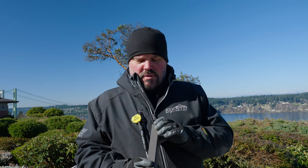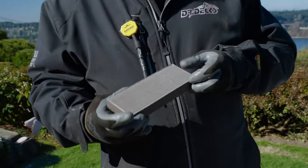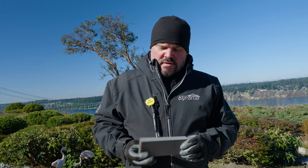We're going to use some glue and activator to get this to stick. It's like PVC cement on your sprinkler system — once it heats up and you lock it in, it really doesn't go away. It doesn't dissolve, it doesn't fall apart; it bonds itself together just like PVC pipe, and once you glue those together they don't leak, they don't fall apart, they withstand pressure. We're using that same technology. You'll notice that once this is done there's still going to be an exposed edge, so we'll take some color-match paint and detail those.